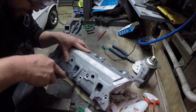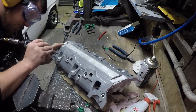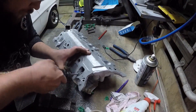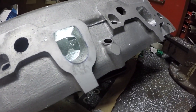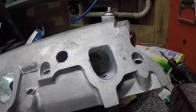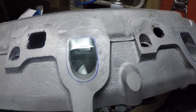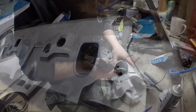And away we go with the porting. It doesn't actually take too long — I think it took about 20 minutes to do one side of the intake for a first pass. Then I came back and did a second pass later once I'd double-checked it with the intake manifold gasket, set it on the head and had a good look. I didn't film all of that but I did take two stabs at it. You can see now that we've got it opened up — looks like a fair bit more air will get through there. There's the other side yet to be ported, which really just goes to show how restrictive it is even when you've got the right intake manifold for the engine — there's still a bit of restriction there.